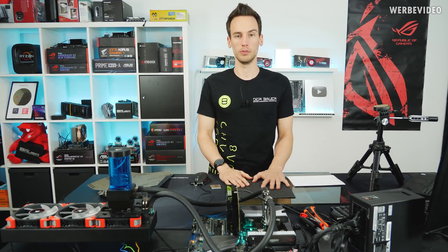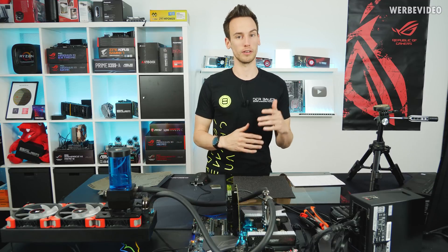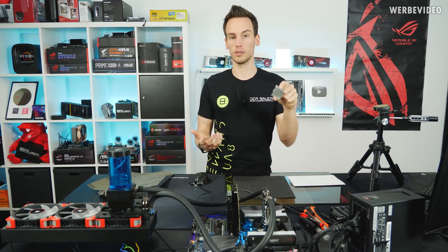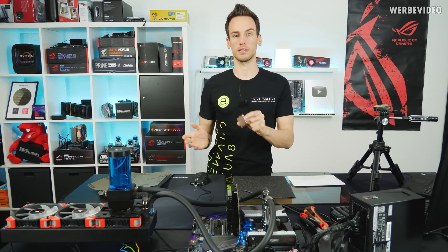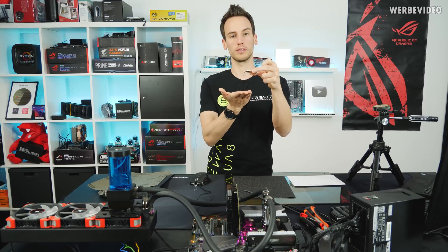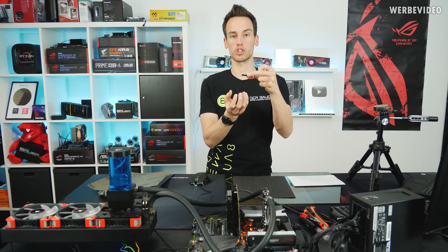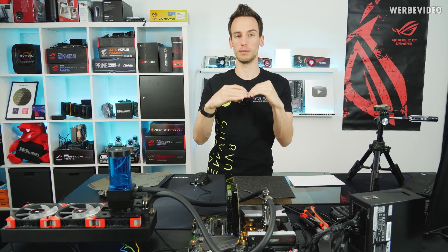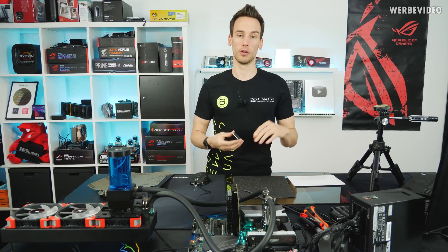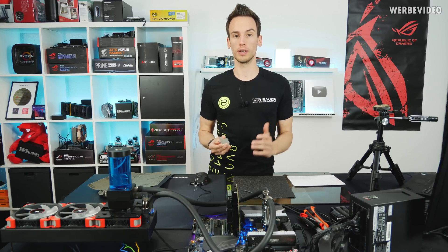In today's video we are going to test lapping of a CPU. A lot of people have tested this before and we all know there is a certain benefit depending on what kind of CPU you're lapping. For example, this is an IHS of a 7820X which is a CPU that's not soldered. The benefit on a non-soldered CPU is not as big as on a soldered one — that's the rule of thumb. With a soldered CPU, the IHS is placed on top, you have the soldered preform which is indium. When the indium heats and solidifies again it shrinks, so the center of the IHS is pulled down slightly. A soldered CPU like the 9980XE will typically have better results from lapping than a non-soldered CPU like the 7820X. But lapping will always give you some kind of benefit.